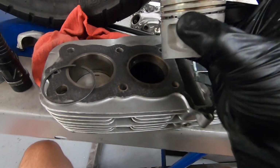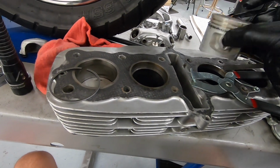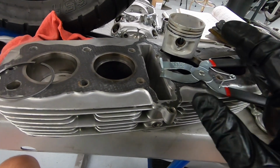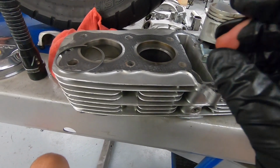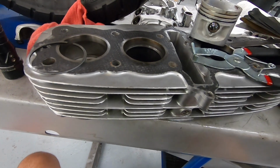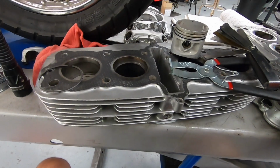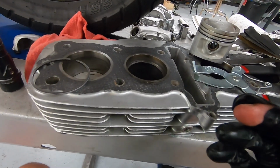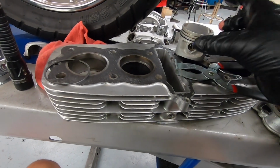According to the manual, the second piston ring should have a 0.02. That's in inches. I think it's right at half a millimeter in metric. We're actually tighter than that. We're at 0.014, so we're 6 thousandths of an inch tighter than what the book even recommends, which would not lead to lower compression. If anything, that might even seal a little bit better.